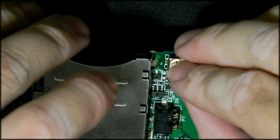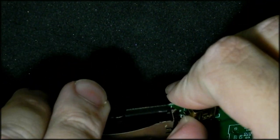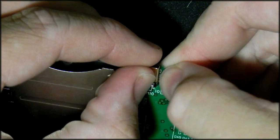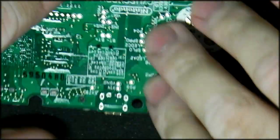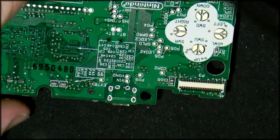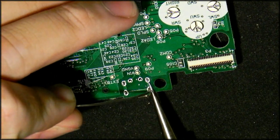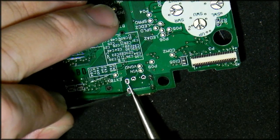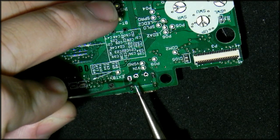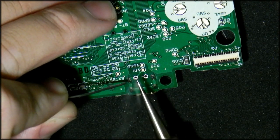So we're just going to drop that in. There you go. And you'll actually see that there's enough surface tension to hold the parts in for you while you start soldering. Once again, I'm using the needle tip. You should actually be using the chisel tip, but most of you will already have needle tips, so I'm just soldering that in quickly. Good advice on a needle tip is the needle itself is actually fairly low temperature compared to the base, so you always use a little upper part of it just to heat it up.